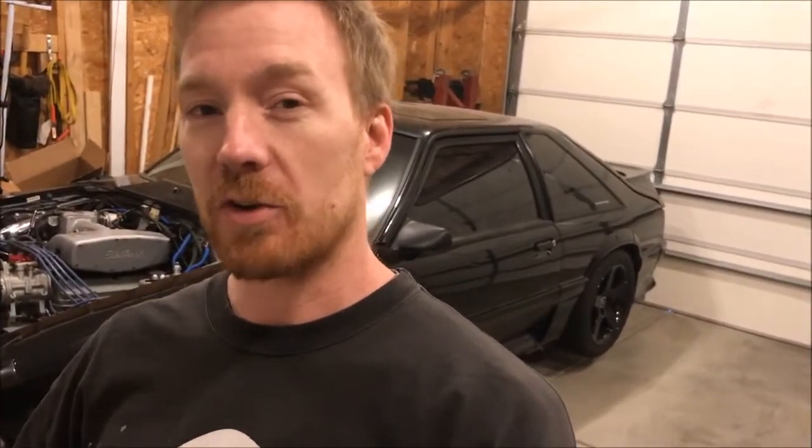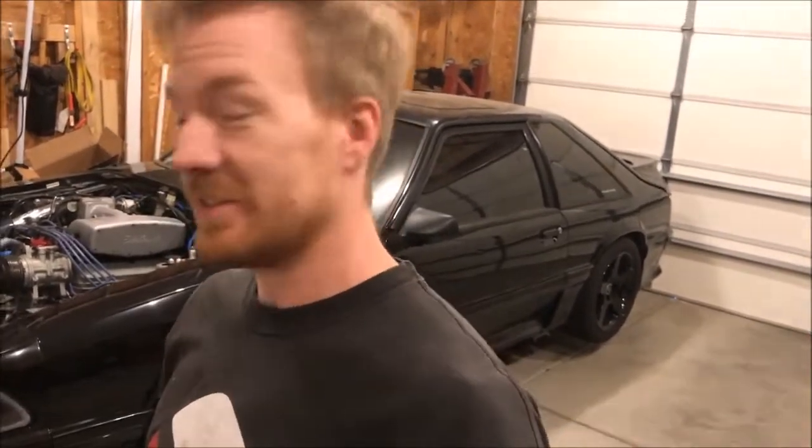Today's the day — I'm super excited, we finally get to fire the Mustang up. I'm keeping my fingers crossed that it works. I have no doubts that it will, maybe a little bit, but I think I've done the best I can building this thing up and making sure it starts on the first turn. We've set ignition timing, we're at top dead center, we should be all good. We're going to prime our fuel and give it a go — I already primed the oil pump, so let's see.